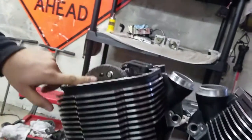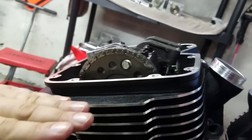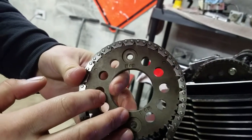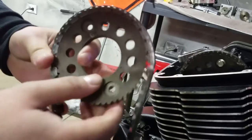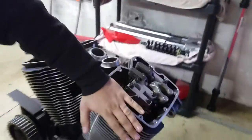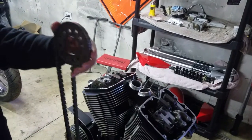If you want to zoom in here real quick, you can see those two little hash marks — they point straight to the top part of the cylinder head. And just like you can see on this front timing chain and wheel, there are those two hash marks. They're going to point straight down on this back cylinder. So that's how you know the rear cylinder is in time, the front cylinder is at top dead center, and then we can just drop our timing chain in and time the front.